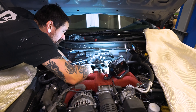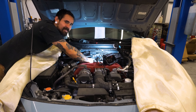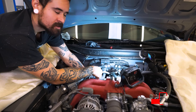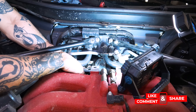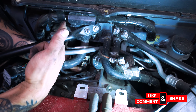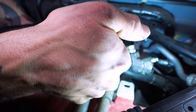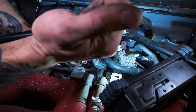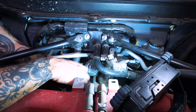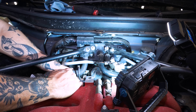What I prefer to do with these starter wires — because they face back and they're kind of annoying to get to — is just unbolt the starter, flip it around, then pop the impact gun on that and zip it right off. It's a little bit easier. Maybe you think differently and that's okay, because there are different people in the world and we accept all of them.